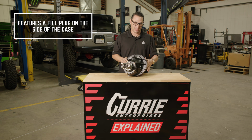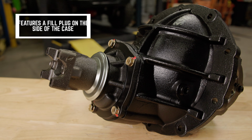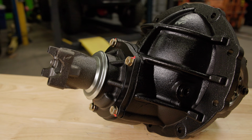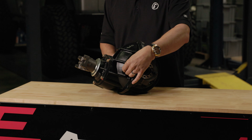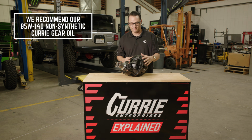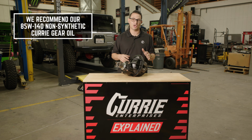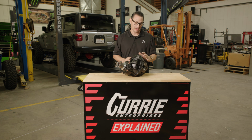Sportsman Third Members all come equipped with a fill plug right on the side. It's going to be a 3/8 hex head. You can remove this plug and go ahead and fill up your gear oil right directly through here and then replace it. Most standard 9-inch housings are going to take 3 quarts. We do recommend our 85-140 Currie gear oil, which is going to be non-synthetic and GL6 rated, which is specific for a Ford 9-inch style rear end.